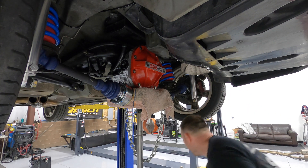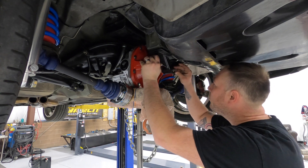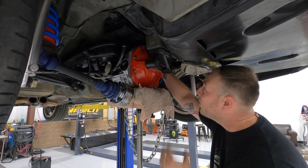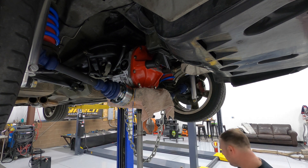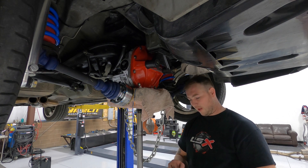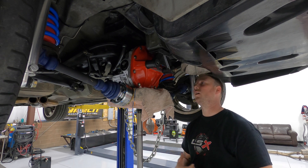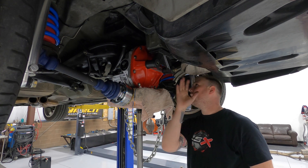I was just struggling here for a minute trying to get everything to line up, and the conclusion I've come to is my golden rule that I strayed from: you've got to keep everything loose. I re-loosened these four points on the subframe and loosened the four points here so I can move the diff around. Just keep that in mind when doing this project — don't tighten anything down until everything's done. Once I get these four bolts in up top, we'll be able to tighten everything back down and paint mark again.